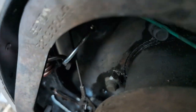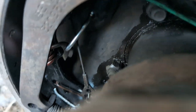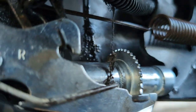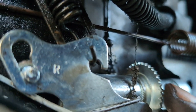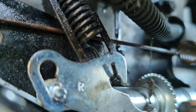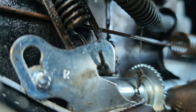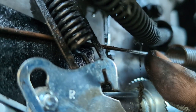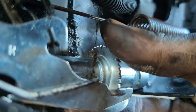There we go. That's better. So if you're routed correctly, you come down through there, shoot down through here, you come down here. And then the idea is when you hit the brakes in reverse, or you hit the parking brake, it's supposed to lift up on this if it can, and it'll turn this wheel, should turn it to the inside.